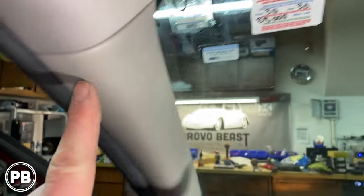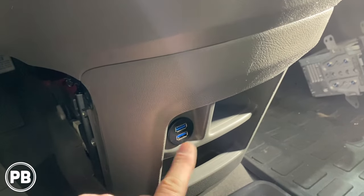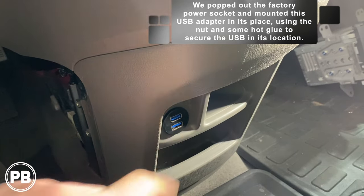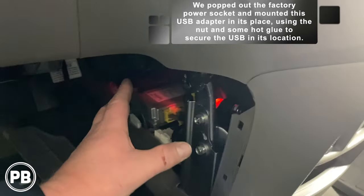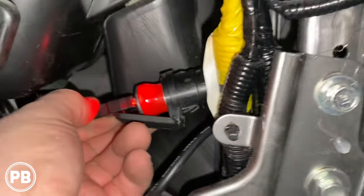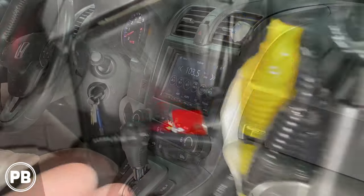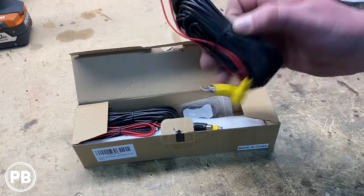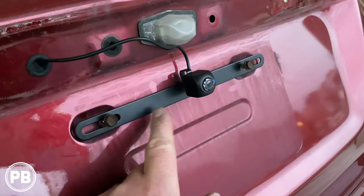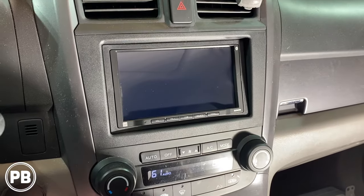We put our mic up here and ran the cord all the way down underneath the dash and up to the radio. We also did a dual USB — one just for charging and the other for the aftermarket radio for Apple CarPlay and Android Auto. We popped this side piece out (held on with two screws), kept the original charger there and plugged it back in, then added a USB charge port for the other one. Everything is back reassembled and it's looking great. If you want to know how we did a backup camera on this CR-V, we'll link that video in the description as well as a card above walking you through step-by-step how to install a license plate camera to this aftermarket radio.